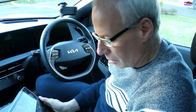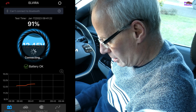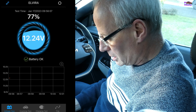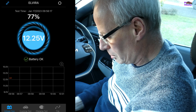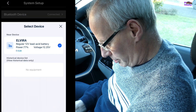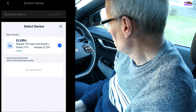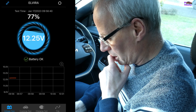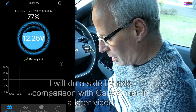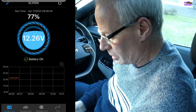To prove that vehicle-to-load will charge the 12-volt battery, I'm going to flatten it a bit with some Kia Connect status requests. We'll look at the before reading — we're connecting now. According to this it's 77%, which is strange because it was 92% before. I've double-checked that the battery type setting is the right one. It doesn't have AGM on the side, it just says 12 volts, so I think this calculation for percentage state of charge may not be correct. But I'll go ahead anyway and do some status checks, then come back after an hour with the vehicle-to-load adapter plugged in.